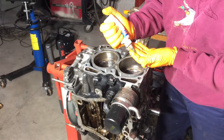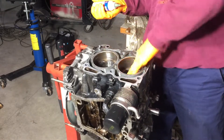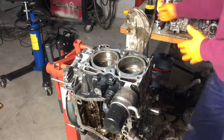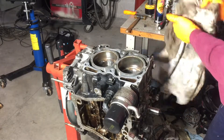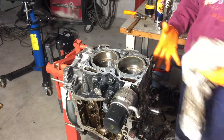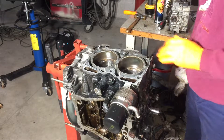It's hard to believe all that cross-hatching is still visible. You would think after all these miles that would be gone. On the DoD delete I recently did on that GM, that one didn't have cross-hatching yet. Not saying it's good or bad, but it's just maybe tested into what they put for a liner.